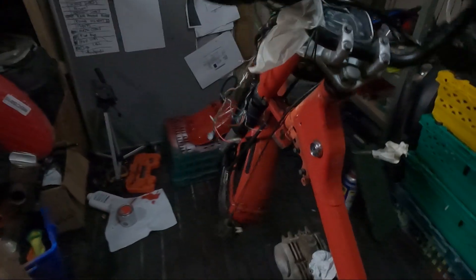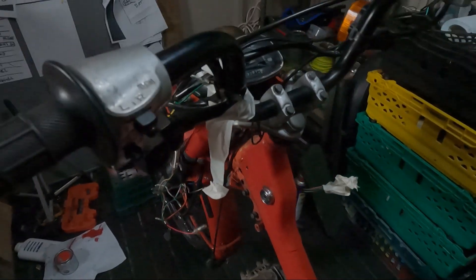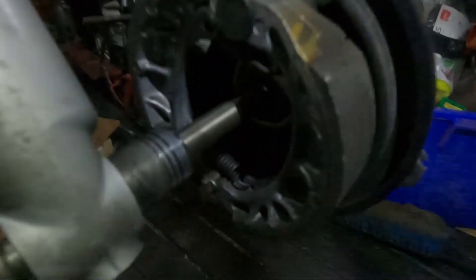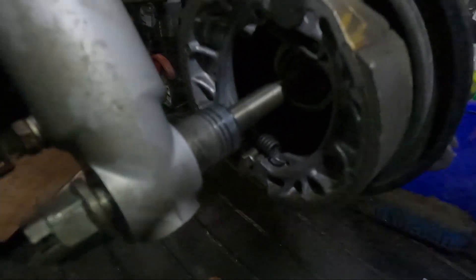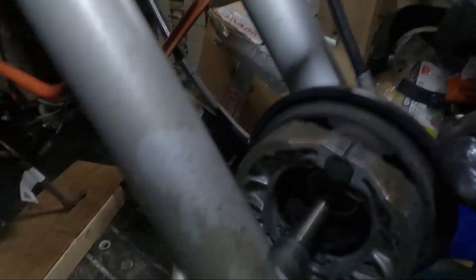Bike's up in the air. I can't feel any notchiness, but I'd probably be able to notice something. Once it's all off and all the weight's gone off it, then I'll find out if I've probably got a massive notch. Uncouple this hose and hopefully nothing too bad. I took the wheel off first. Looking very smooth in there — spacer goes on the left side when I'm facing the bike. The front seems all good; I'm happy with the front bit.